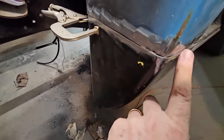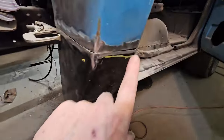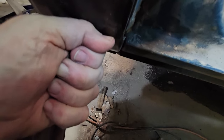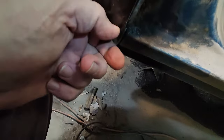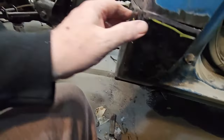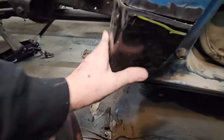This one, this is out here facing. This one's a little bit off, but I really don't care because the most important thing is getting this line and this line right, okay? So I've got to take my knee and push on here because she needs to be bent a little bit, but she'll get there. I'll get a tack in right about right here to hold it in place, even with the rocker. After that, this gap closes up a little bit, and then we can let loose of this and let everything just relax and settle because, you know, she's still got movement. I just got her held up with one piece.